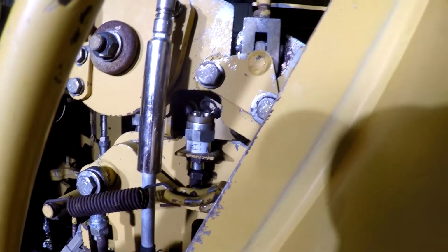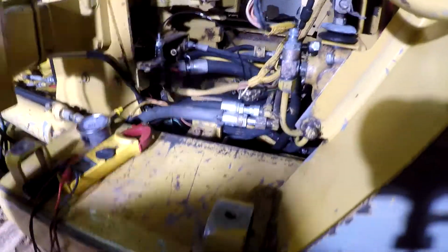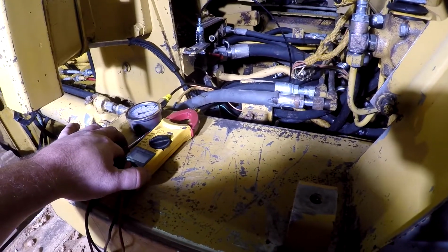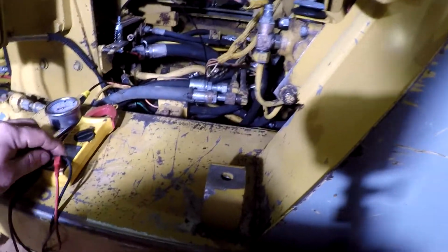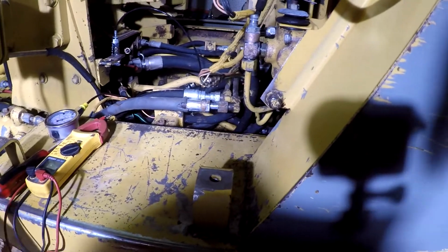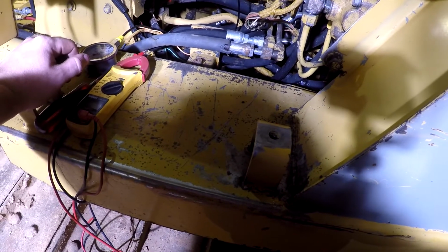because it seems to be a decent amount of load to operate that solenoid. And something else I run into, as you know, a solenoid is basically a coil. Testing with a digital meter here, the voltage that goes into one side of the coil comes out, it kind of back feeds through. So it will fool you on which side of the solenoid you think is hot and which side you think is a ground. I've run into that stuff before.